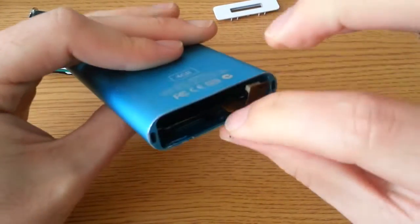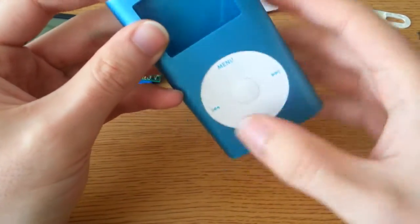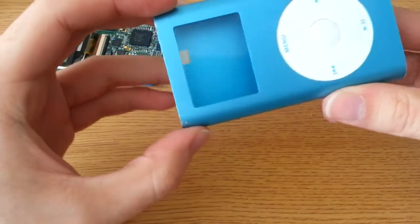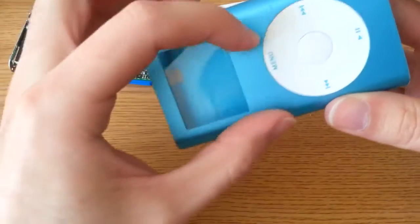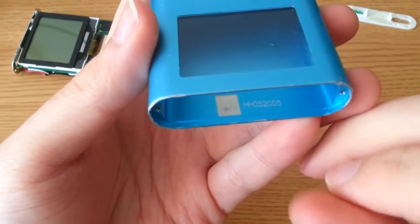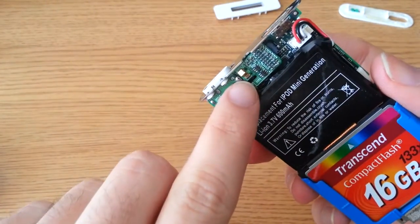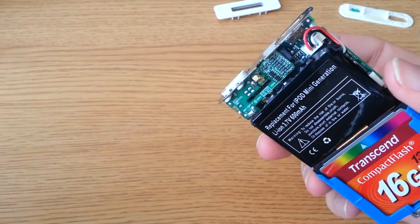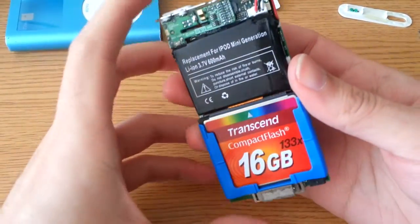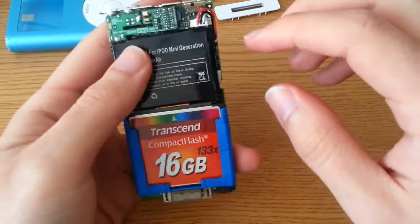You should hear it click as that little tab goes into place. As you can see, I managed not to scratch it up, at least too much. There's a clear little plastic window that goes into the anodized aluminum casing, which just pops off with adhesive if you ever need to replace it. Interestingly, you can see it's marked with a code. In addition, there's this little exposed area here — there's a little metal clip that grounds to that, which is pretty cool — they did that in order to ground the case. And here you can see I replaced the battery — I stuck some double-sided tape on there.